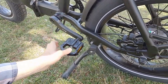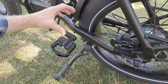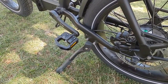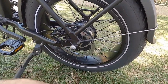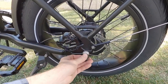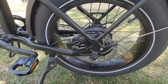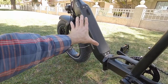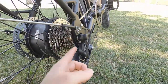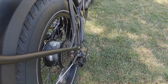I do want to point out that the kickstand — although it doesn't create pedal lock — there are times when I've been riding and my heel would strike the folding part right here. Because it's such a wide hub spacing back here, the frame is fairly wide and the pedal and crank arm get pretty close to the frame. Another quick look at the rear dropouts — we don't have a dedicated torque arm, but we do have a torque washer and the frame is fairly thick. Make sure the bolts and everything are tight over time, because you don't want rattling to chew into the frame. The battery weight is low and centered — pretty good. And then there's torque sensing pedal assist — that's unique about Surface 604. This metal plate actually gauges how hard you're pushing when pedaling. It's not just an on-off cadence sensor — it's much smoother and more dynamic.